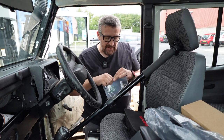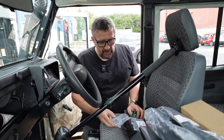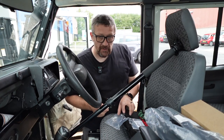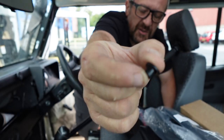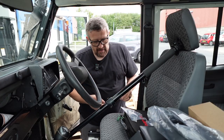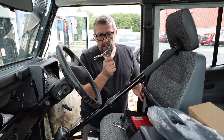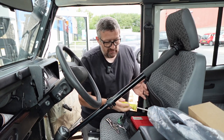That's going to work in combination with something else we're going to fit in a future episode. There are no instructions included, so I went online and LOF do provide instructions, but they're shown with a pedal box on the bench. I thought it'd be better to do it in the vehicle to give you real world fitting advice. You get a spring, CNC machined top hat washers, and U-washers which are a Land Rover part — apparently quite brittle, so we need to be delicate. You need a 17mm for the stop bolt in the engine bay, needle nose vice grips, and a screwdriver for pushing the bushes in.